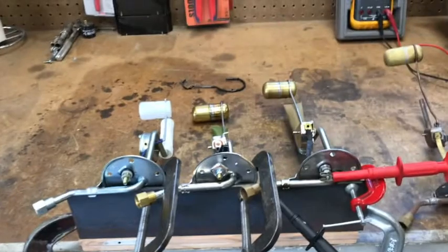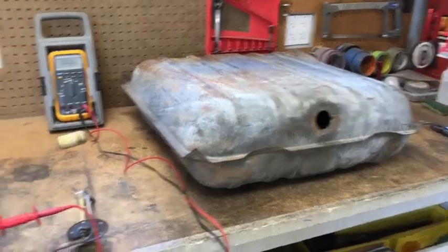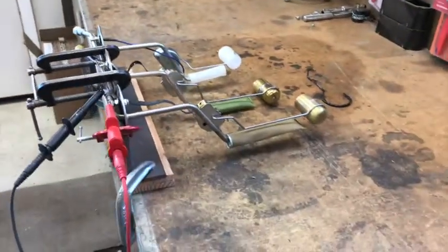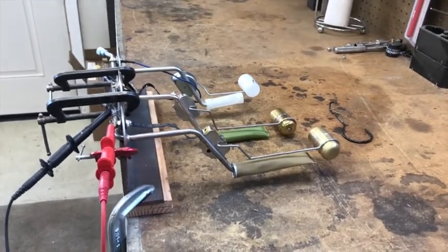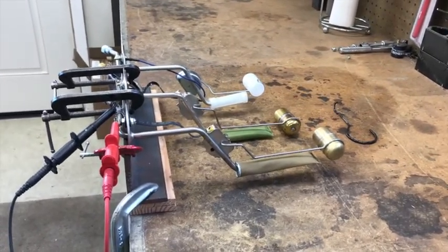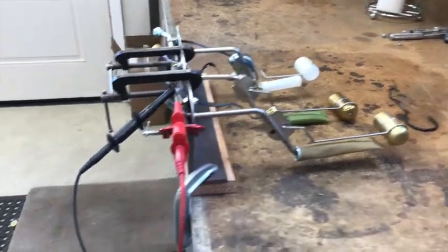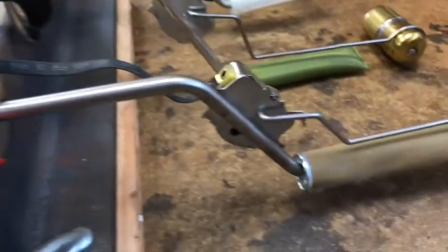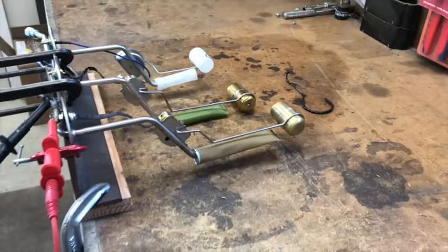The one on the right has been put into this spare tank, and the float arm is adjusted. Not this one — that's the one that came with that tank. The one here closest to the camera — the float has been adjusted so that it hits the bottom of the tank all the way down when it's at its lower limit. You can see there are limits here on the rheostat. See the little tabs?